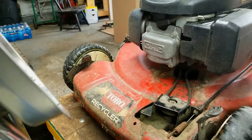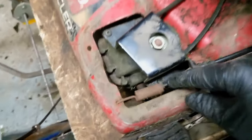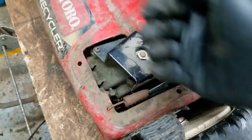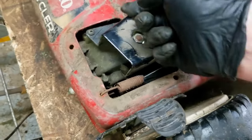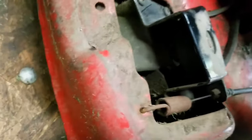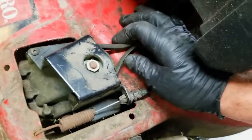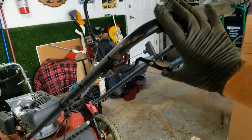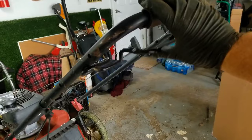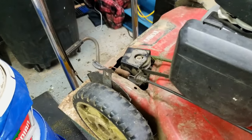To get the belt back on, all I had to do was remove these three Robertson screws, take this cover and fold it over because it's still attached to the cable, and then I just reinserted the belt around the pulley. Now it's back in because I put the cover back on with the three screws. Testing the tension here, there's definitely much more tension than there was before — you can see the cable pulls on that assembly and tightens the belt.